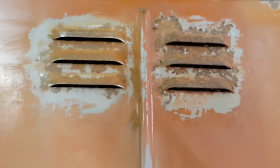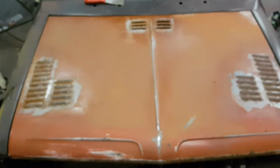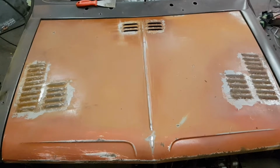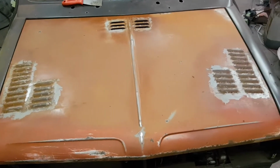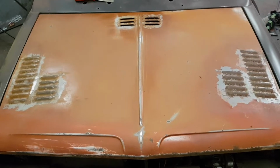So I'm going to crack on with this. Get the whole bonnet sanded down. Going to get it all done, the edges all the way around. Get it sanded down, we used 80 grit. It's so tough. But I'm going to use 240 and then maybe a 600 grit, get it smooth, and then prime it. I'm going to do the underneath of the body as well.